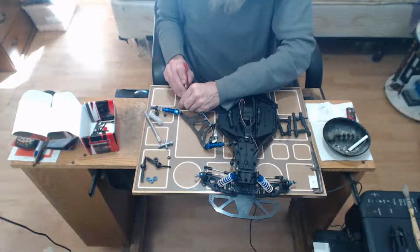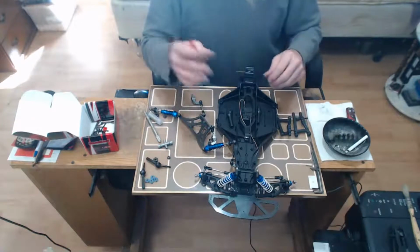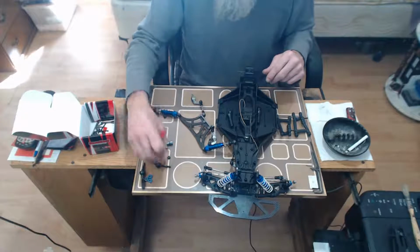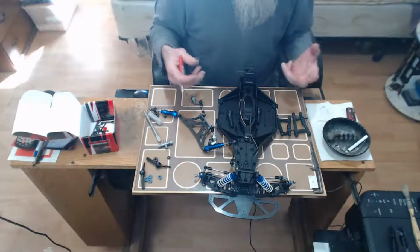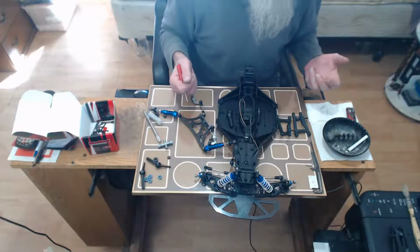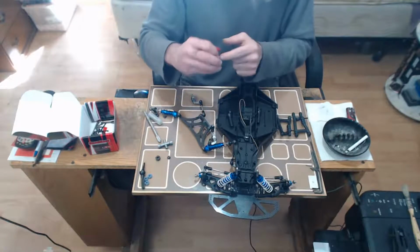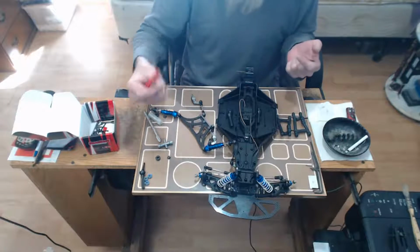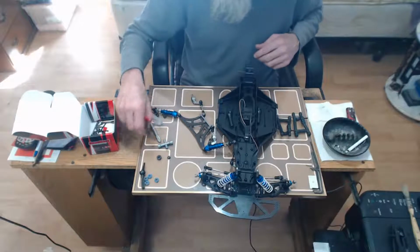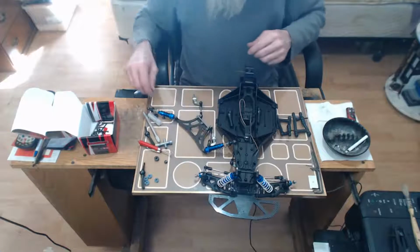but they fit real well. I bought a set of Traxxas TRX green ones for my tarp, and those bearings, half of them just fall in and out. The bearing slides in and out of the race. It's not even holding the outer race of the bearing, so the bearing won't really be doing what a bearing should have to do. You know, the outer race needs to be at least held so anything riding on the inside isn't just spinning the entire race and the entire bearing assembly inside it. So there's some quirks in there. I bought some replacements for that one, but that's that.